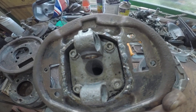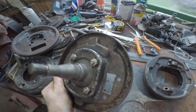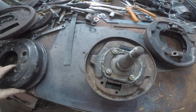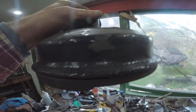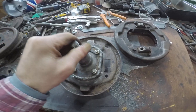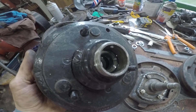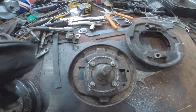You can see it recessed in there — about 21mm. That way you can run Morris Minor brake shoes and brake cylinders on the Austin 7. But you have to weld it all in situ. So I've got the hub bolted in place, then get my other drum with a hub on it, fit that in there, line everything up, and then weld it all in place.